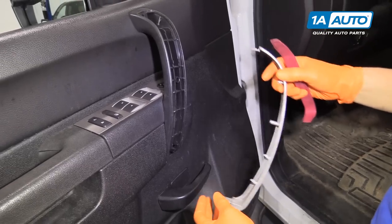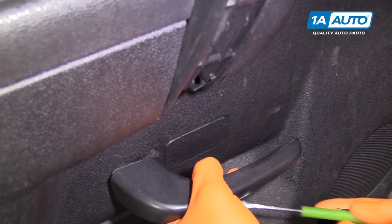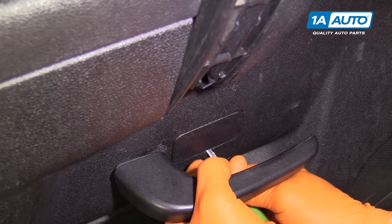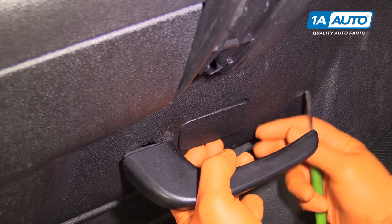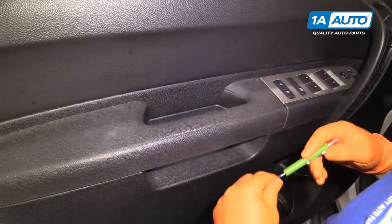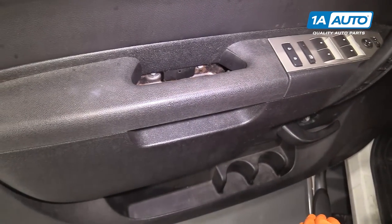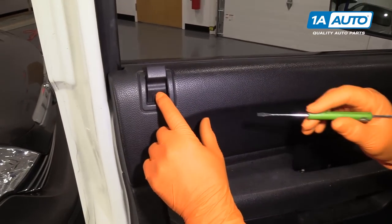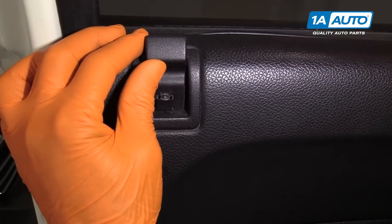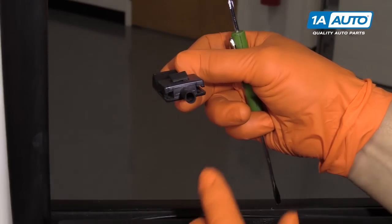There's your clip on the bottom and clip on the top. I'm going to move down to the inner handle here and this little trap door — I'm going to pop that open. I like to use a little pocket screwdriver; it seems to be a little bit easier. Then the handle here, we've got another cover back here, pop that free. The last thing is the door lock — it has a little notch and we're going to pop that out. It stays like that because it's just a clip that pushes in when we readjust it on that rod.